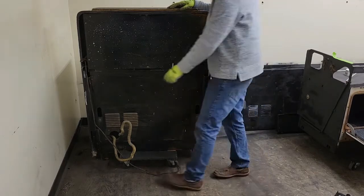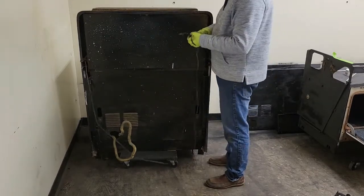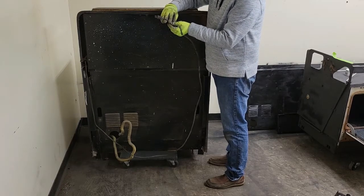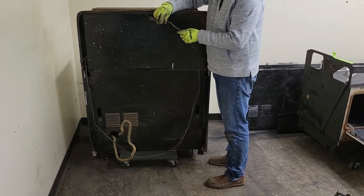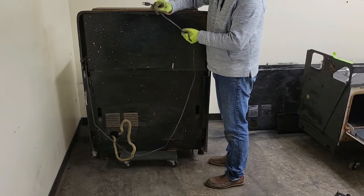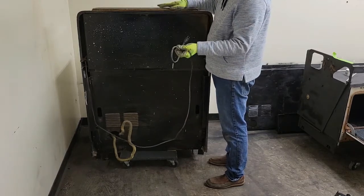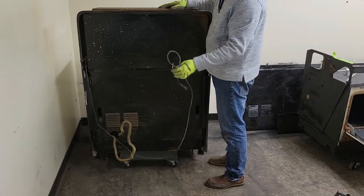This is pretty typical. And because this is a C90, it has a light, and this is the original plug — and it's completely frayed. Whenever you have 70-year-old wiring, it's not that complicated to rewire a lamp. Don't plug it in to test if the light bulb works. Just replace it, then test later. There's no reason you can't have a working light fixture on a stove, but you don't want to use brittle, cracked, 70-year-old wiring to do it.